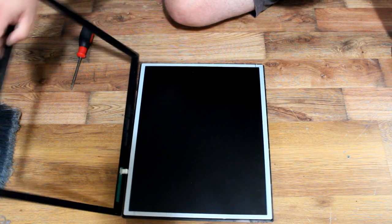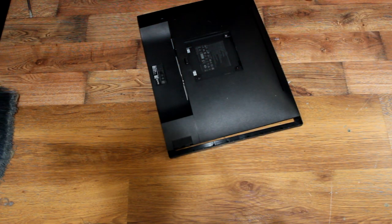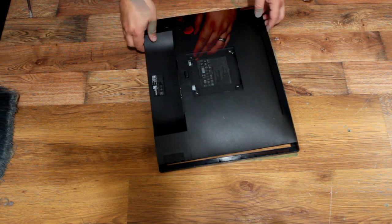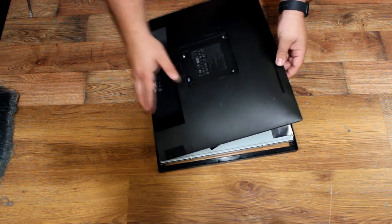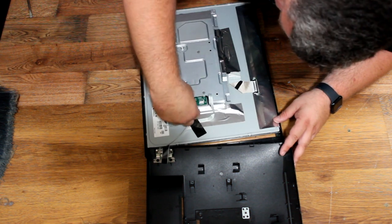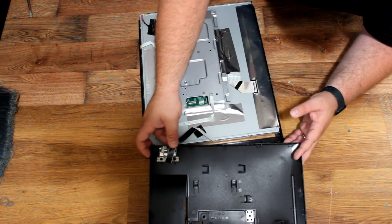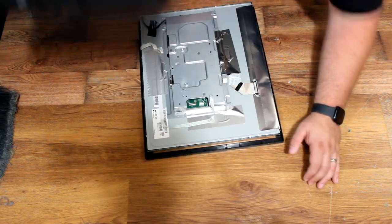We're opening it up like a book, and there you can see the cord at the bottom. Then you're going to have to take the screws out from the back to get the back piece of plastic off. Once you have those screws out, it opens up like a book again because there are a bunch of cables on the inside that we'll have to disconnect from the screen — you don't want to damage anything. These cables aren't super difficult to disconnect, but with my fat fingers I stumbled through it, so just remember to be super careful.